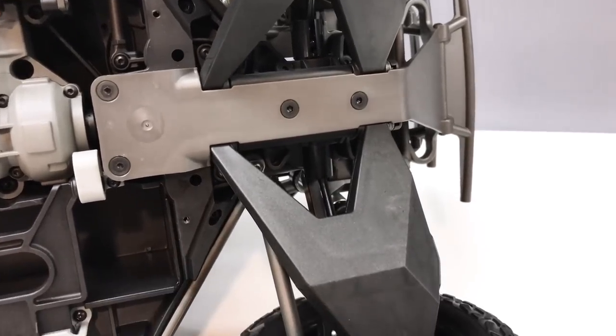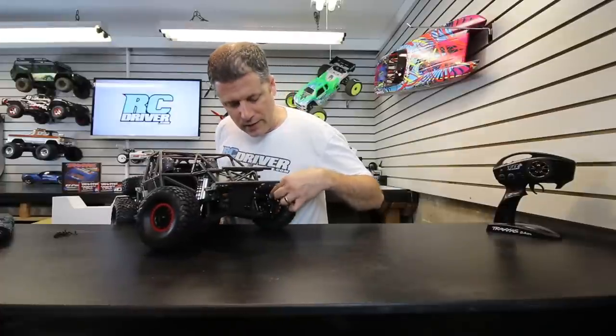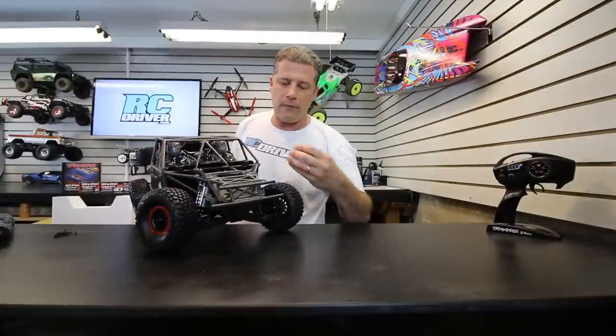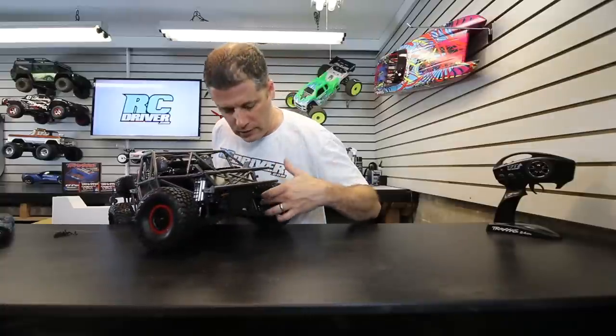And it's a kingpin style setup. So over here, we've got these kingpin balls out here that secure the arm to the hub, and everything is captured. That's one thing I noticed. We've got the sway bar link here. We've got the links over to the steering.